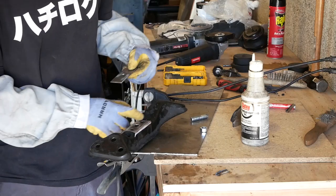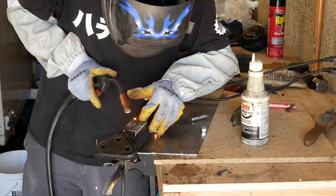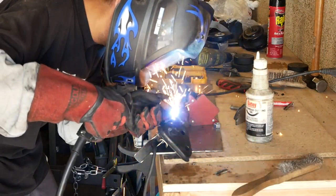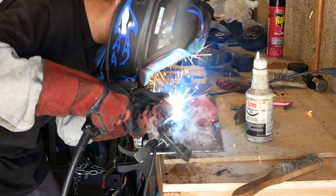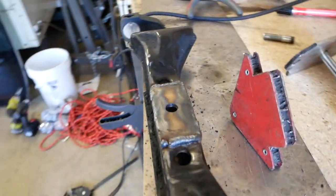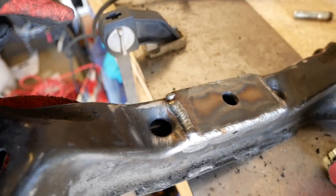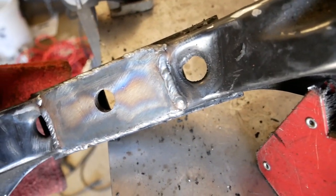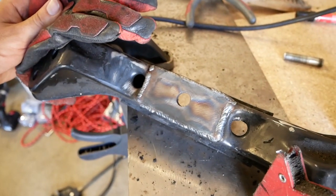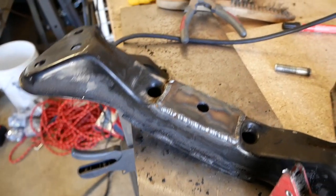Here's my piece of eighth-inch steel and here's the crossmember. You can see the plate welded on top — I'm finally getting a little more practice with welding and getting back to how I used to weld pretty consistently. That plate adds eighth-inch plus whatever this is — a little less than an eighth-inch — all on top, so that's all nice and thick.